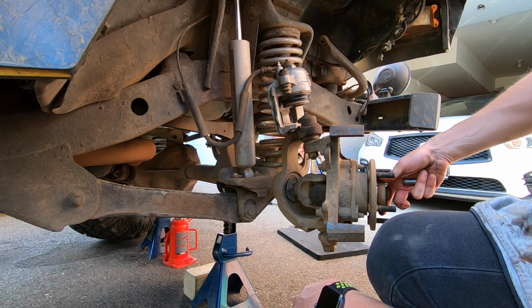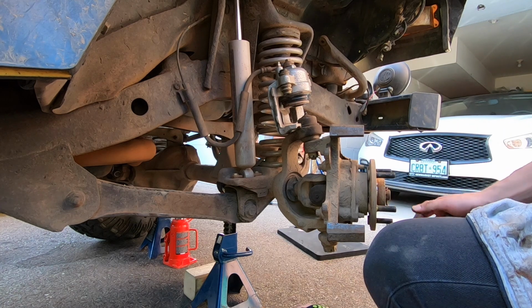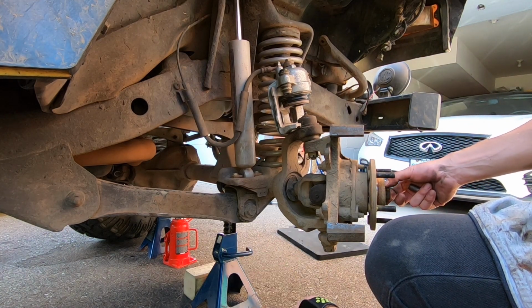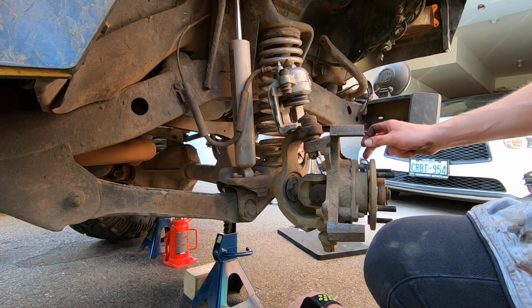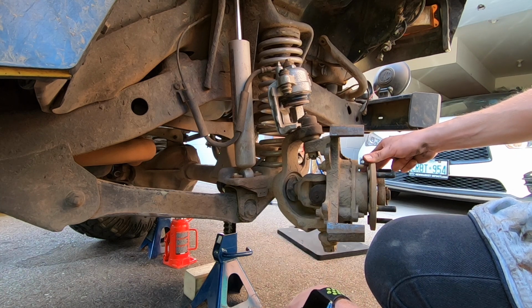I'm gonna go pick up some pads and a hub. But it is pretty simple. It's 3 bolts in the back here, a 36 mil for your axle nut, and that's it. You literally take it right off and you bolt in the new one with 3 new bolts. So we will be getting those. So hold on for that video, guys. It is coming out. Definitely stay tuned.